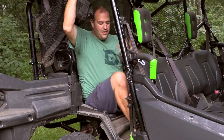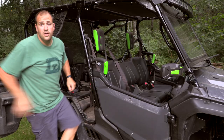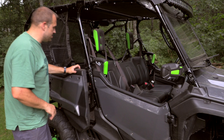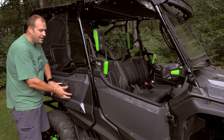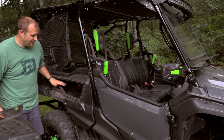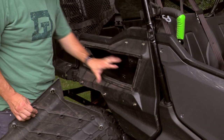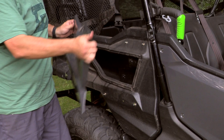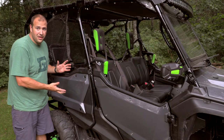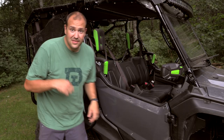Something I also really like is that with the four doors, the door itself is actually hollow. You might think — who cares, it's lightweight — but once you put these body panels on with quick-release hood clip buttons I found on Amazon, you snap these off and I was able to cut the panel, put some weather stripping in, and now I have an amazing storage area. Some guys are even doing spray insulation to make a quasi-cooler. I use mine for tools, a towel, rain gear, and first aid kits, and it's mirrored on the other side as well — snaps on and off really quickly.